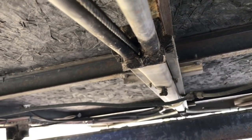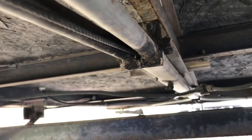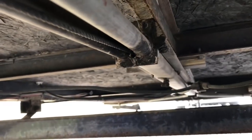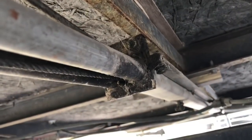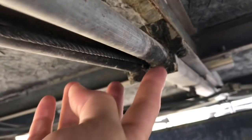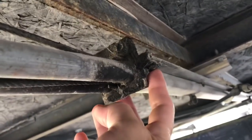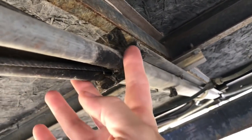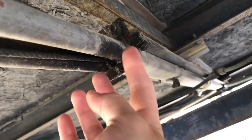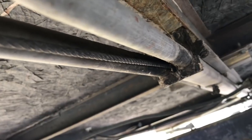I'm going to be coming in and out of the video making corrections because it is the first time I'm doing it. As we saw, we removed the retaining bolts for the tubes at the exterior corners, but I thought we would just be able to drop the tubes. However, there are retaining bolts that need to be removed for the spring tubes — they have a flange that's bolted to the main tube. There are two bolts, one on each side, and removing those releases the squared flange with the two spring tubes, allowing you to pull it out and drop the corners to get the springs out. Those are also 7/16ths.